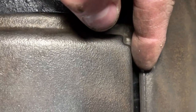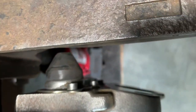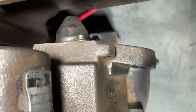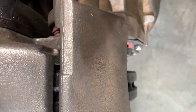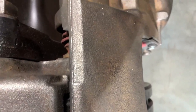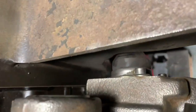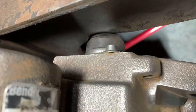There's a new brake pad - this here is a wear marker. When it wears down to the maximum, you'll see that this mark will align with this mark. Now if you look at the back with a new pad in, you can see the rubber cap was touching the frame before. Now with the rubber cap on and the new pad in, you can see the clearance we've got. With the pad out and the caliper pushed all the way back to the max wear marker, you can see there's not a lot of clearance - basically the thickness of the metal and a couple millimeters of pad, which is the legal limit. I am not touching at all on that rail anymore - I've got full clearance and it's not going to do any damage to this caliper whatsoever.